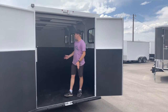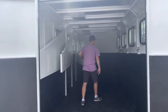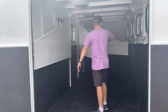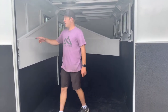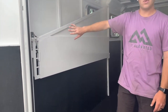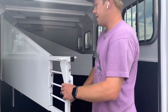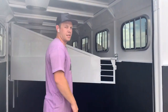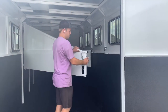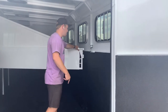I'm going to show you how easy it is to shut all your dividers — they're just slam-latched, so you just push on them and they slam shut. This back divider is kind of unique: you can stow it against the wall, or just open it when you've got all your horses in here. It slides out and slams shut just like the others. One thing you want to make sure you don't do is keep this slid in all the way, where you can ding your trailer.